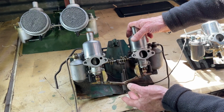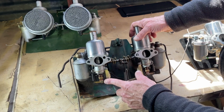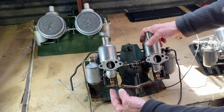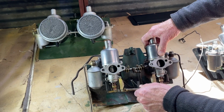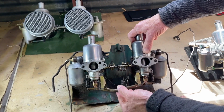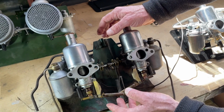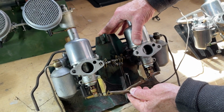But these are really harder to work with. They're more difficult for maintenance. They're more complicated in terms of getting them just right. The way the jet seals are packed with cork, it's much more fussy. This has also a jet that will come down. It's a little different design, but the pivots are all generally worn out, and the choke mechanism is usually full of lost motion. You can see somewhere right here. And as a result, you just have a somewhat sloppy actuation of the choke assembly.